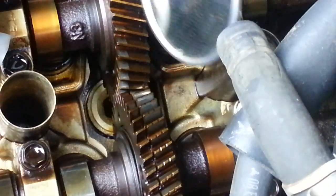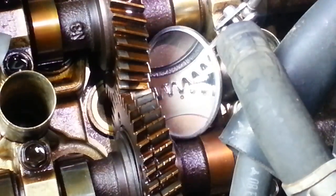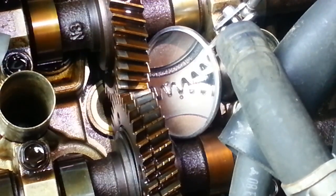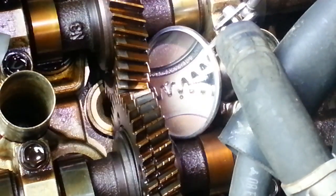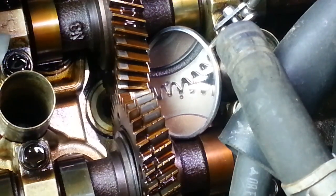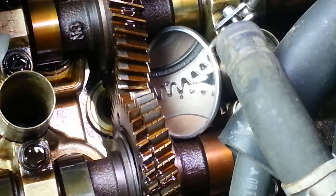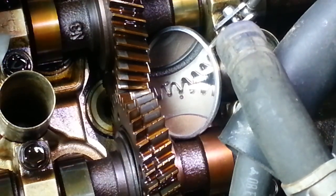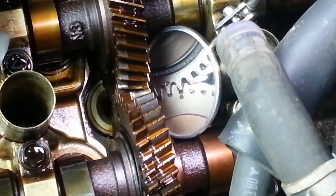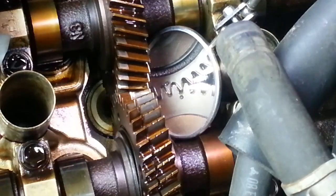And look what I found on the driver's side. There are my single dots, 1 on the top, on the tooth, 1 on the bottom or outboard cam, the exhaust cam being in the valley. But look again, they're 1 tooth off again with respect to each other. So I don't know if that's just coincidence or somebody goofed up the last time they were in here working on this engine. I'm inclined to correct that, especially since I'm going to be taking this side apart for sure. And I'll probably go ahead and take the cams out on the passenger side and correct that too.